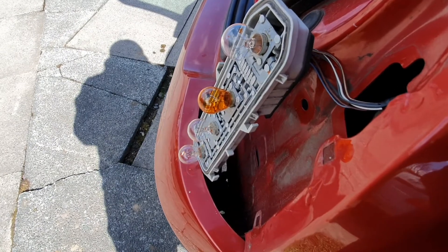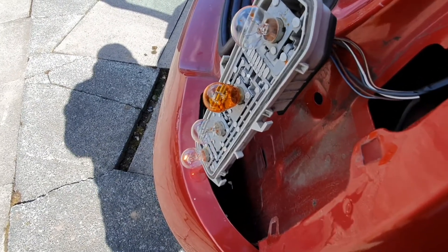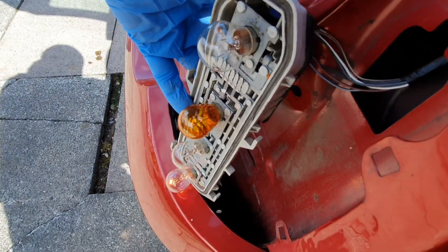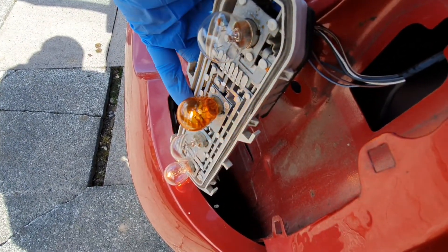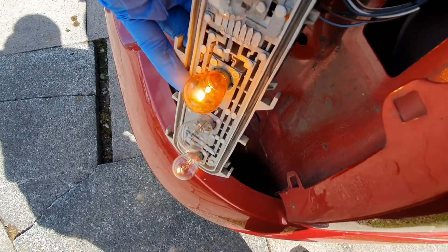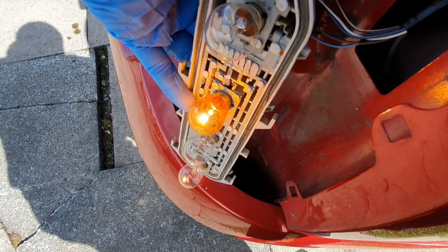Just come to the back of the car — you can see that the hazard lights aren't flashing but the stop tail light is. Just pull on the wiring. You can see there that's the ground wire, the black wire in the back of the bulb holder. Plug the ground wire and the bulbs sort themselves out.